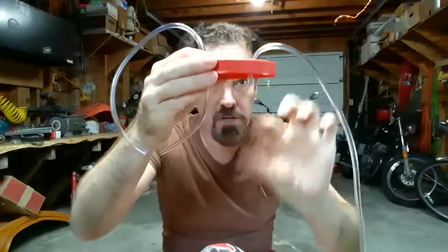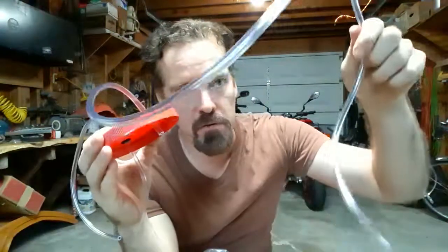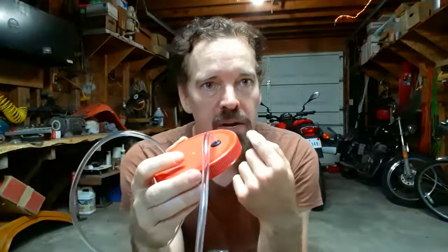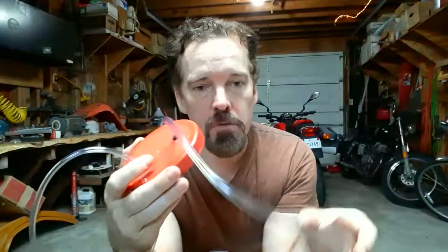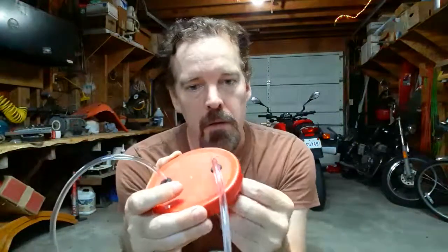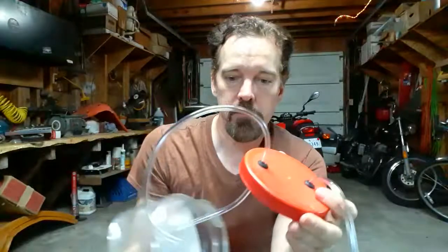The second hose — the long one — does not reach the brake fluid. It's possible to bleed your brakes with just a hose: you loosen the bleeder valve and suck on it, and you can watch brake fluid fill up the tube. But if you go too far you'll get a mouthful of brake fluid, and if you stop before it reaches your mouth you then have to blow all the fluid out into a container and it'll dribble all over. This way all the fluid stays inside my jar.